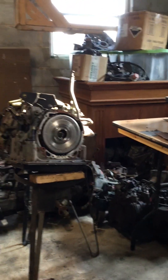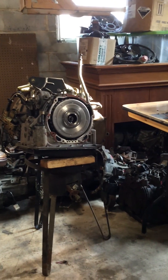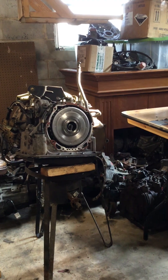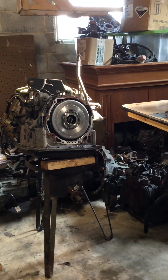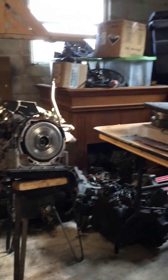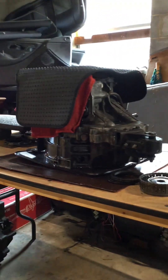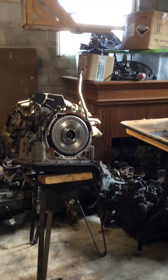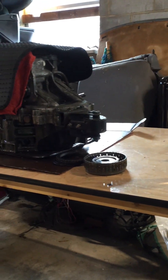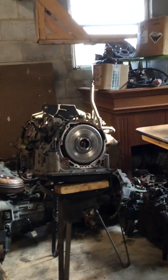For those who don't know, a 1.9 transmission is pretty much the same transmission as a 1.8. The only difference is the bell housing. The back half of the transmission — all that stuff — is pretty much identical. Your torque converter, your drums and stuff like that — most of that stuff is all compatible and interchangeable. You just can't bolt a 1.9 transmission up to a 1.8 because the bell housing is all different. I just wanted to let everybody know that. But I'm not going to stay on too long — I just wanted to basically get on and let everybody know what the update was on the old slush box.